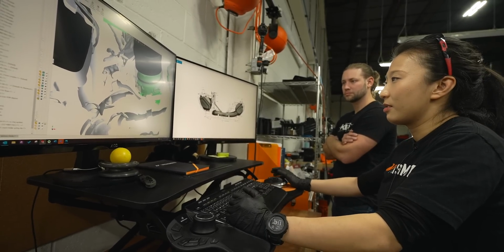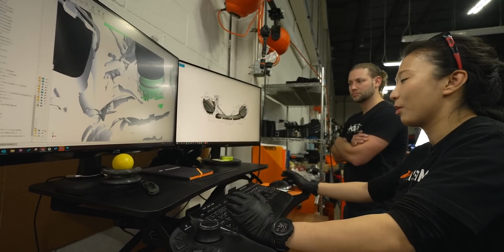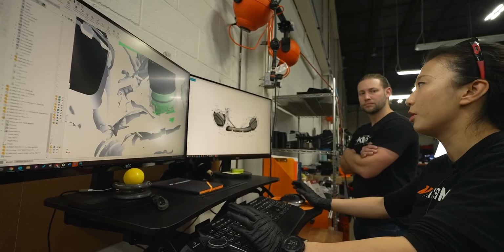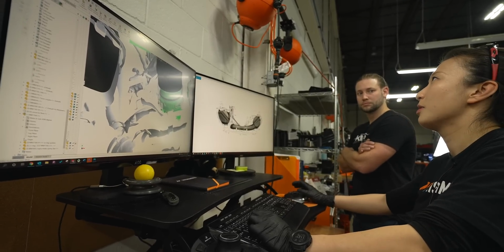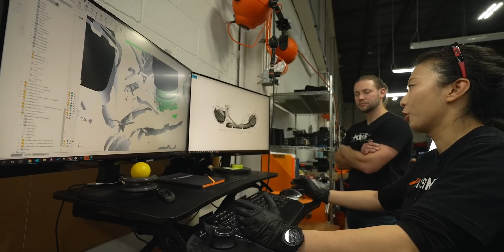That's another process, again not relevant to this vehicle, but we've also validated the necessity of the heat shield because we ran with and without it. And there's, I think, 5 to 7 degrees Fahrenheit of temperature difference on the gauge. So you do need it. Right. Because you don't want to cook your intake air.